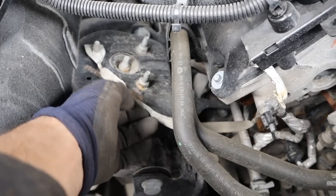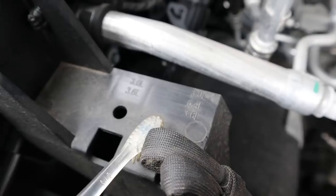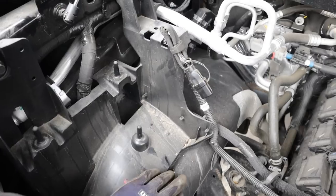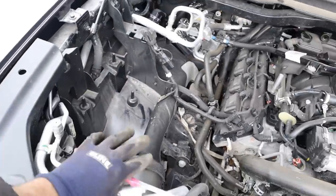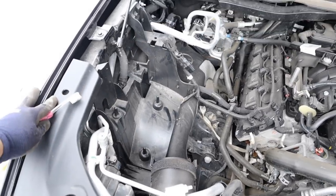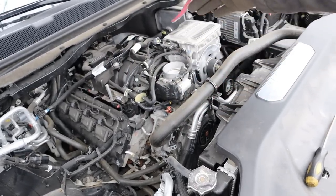Look at the ground strap between the body and the engine — it looks like it's made of paper; the first thing I'd do is upgrade that. This bracket here is made for every other engine except this 5.7-liter engine, and once you remove that bracket all you have is this thin little fender liner in the wheel well underneath. That's because none of this stuff is structural — it's a body-on-frame vehicle, which means the frame runs over here and this is just a hang-on panel. Overall, under the hood things are pretty well laid out, easy to get to, with a lot of room to work on.